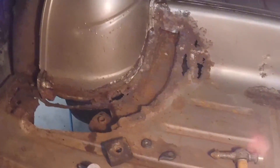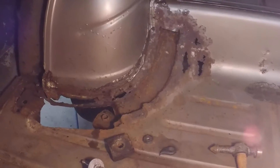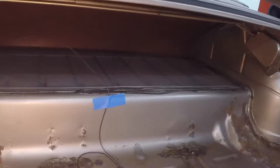There's a rubber hose up in there that drains the channel from the rear window — it drains out from the wheel well. And if they rot or break off, that water just runs down in here and rots that out. So I will be checking those hoses to see if they're broken, not in the right place, disconnected, or rotted — to see if that's where the water was coming in. But the upper package tray, all that stuff is like perfect too.